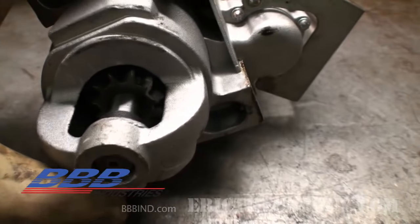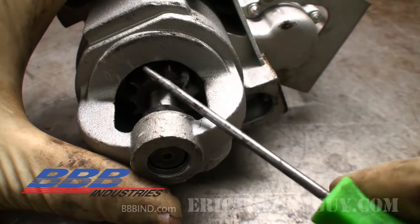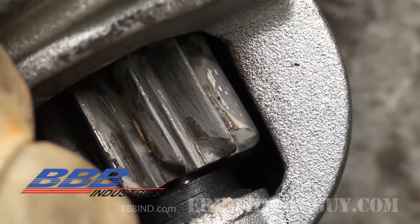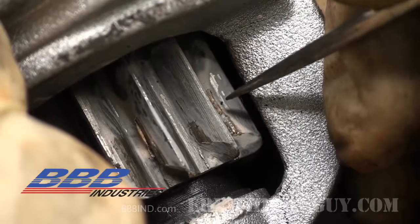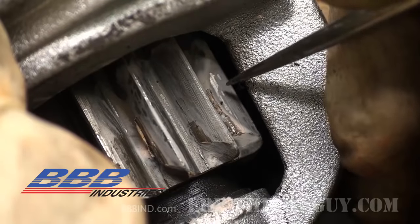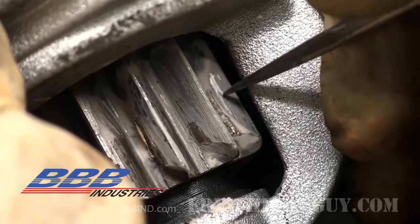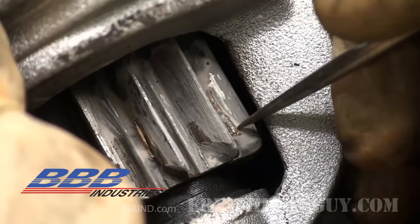All right, now that we've done that, let's remove the starter and take a look at those teeth. I've removed the starter after starting the vehicle a couple of times and now I'm going to look at that tooth contact pattern. Here is what I hope is a good view for you — you can see in this area here is where it was making contact. There's actually gear paint you'd use for differentials and things like that, which might do a better job of this, but I can see quite clearly where this is making contact, which is exactly where it should be — about two-thirds of the way down.